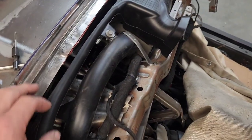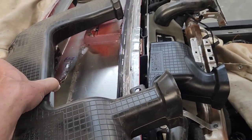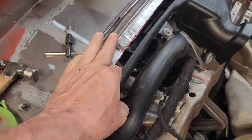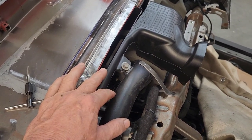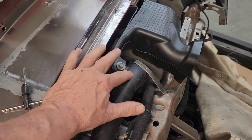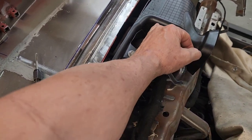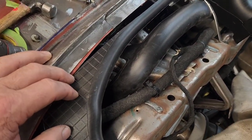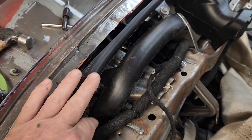I've got this piece trimmed up and in here. As you can see, there's very little left compared to the size of the duct we started with. I've got two options: I could just cap the back and live with whatever that volume is, or I could remove this connection point between these two pieces, cut these two tabs off, and actually come in right here and widen this duct back out a little bit. That's the option I'm going to take, just to give it a little more volume since there's basically almost a half-inch between these two ducts.